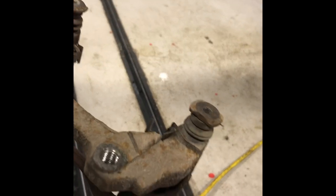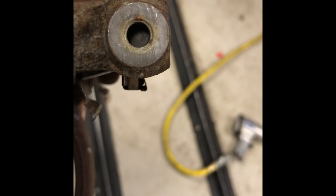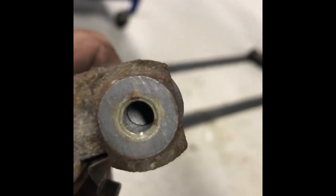There is a top pin and a bottom pin. You won't see it now, but when you pull them out, you'll see the pins are different. And you can see that there's a shape there. So that shape's got to fit perfectly onto the caliper piece. It's very hard to explain, but you can see there's a cutout on the caliper there. That cutout must fit in there perfectly. So they might be slightly skewed at the moment, but we'll make sure they're straight and we'll put them in.